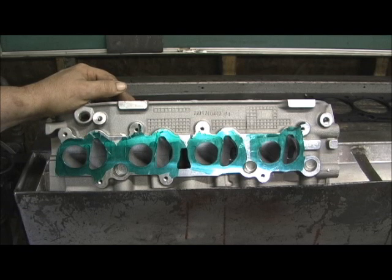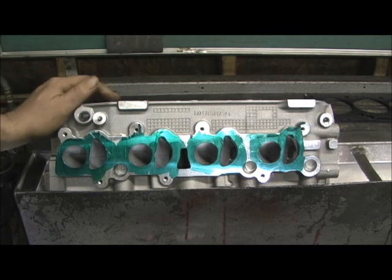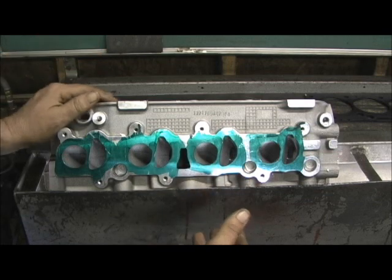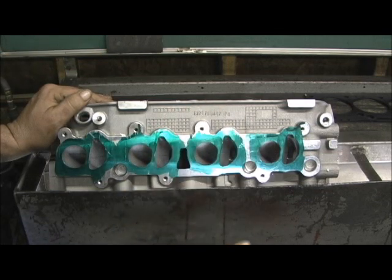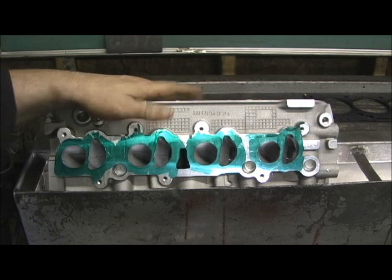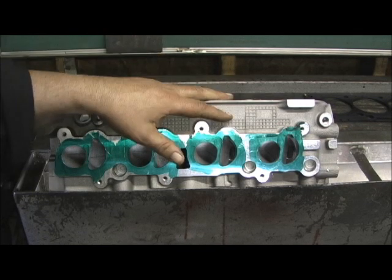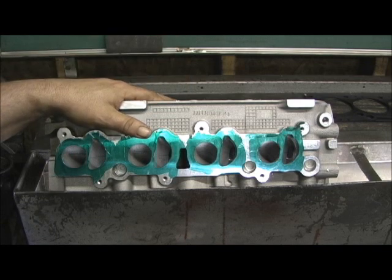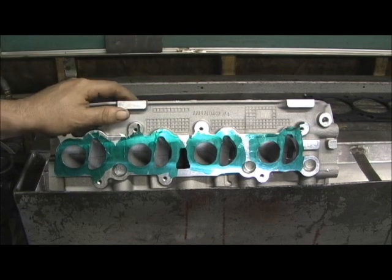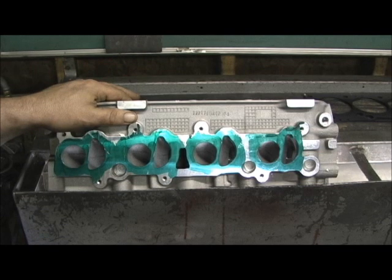This is how I've really been keeping the shop running the past few years. I'll take a regular car like a Toyota Camry, a Honda Accord, or a little Ford, go in there and alter the port shape, do my valve job, unshroud the chamber. I can take a car that was getting about 20 miles to a gallon and it'll get about 25 miles per gallon — some will get three more, some will get five. The best report was on a Honda VTEC head where I picked up nine miles to a gallon by port shaping it.